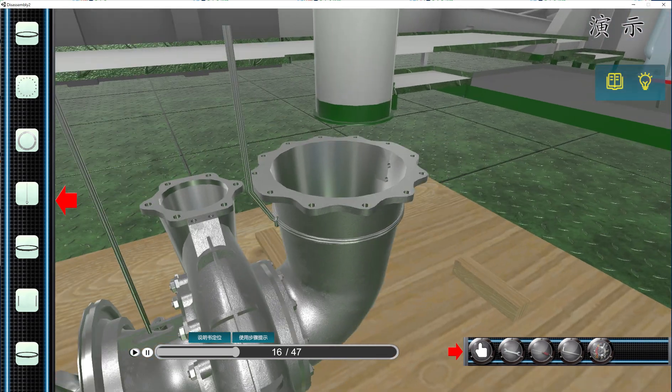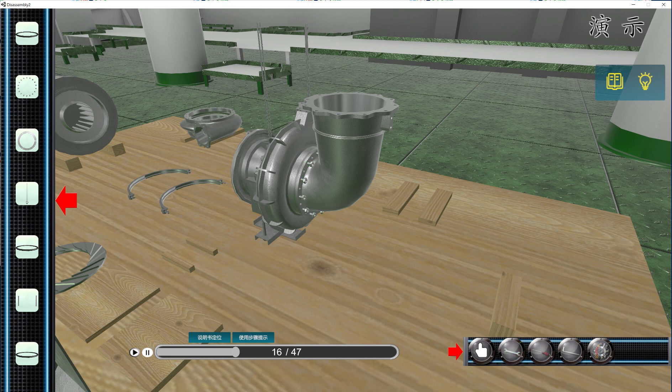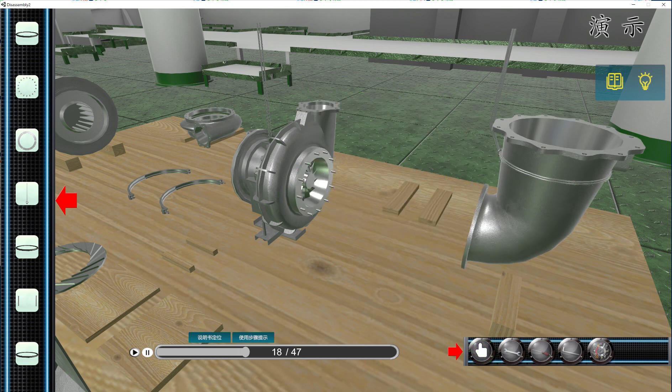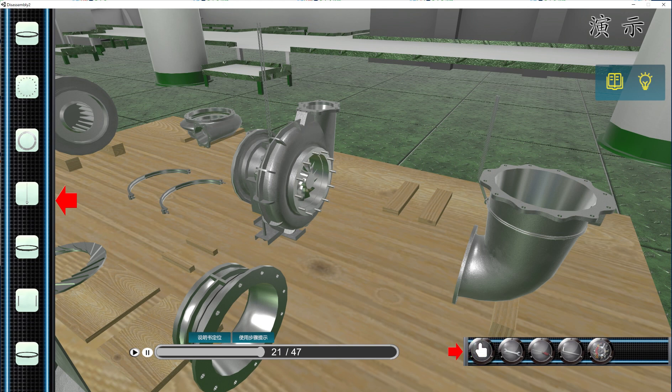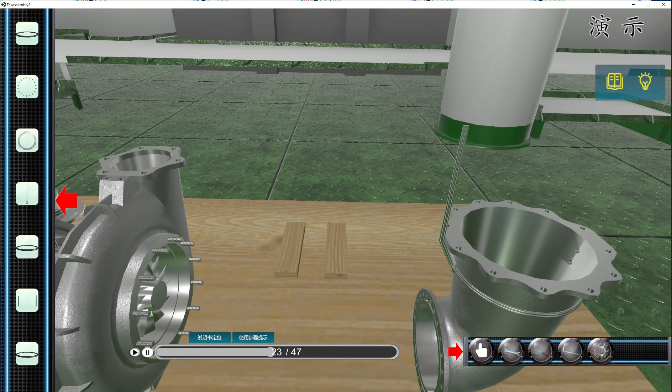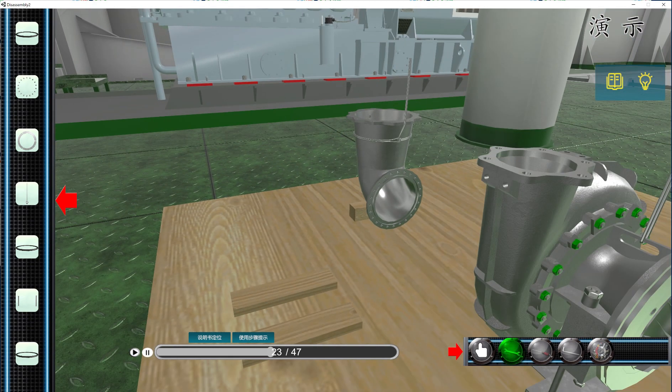It's a very nice job — you need to have the feeling of the shaft, whether it's touching somewhere or not, whether your turbocharger is aligned. There are really a lot of factors to take into consideration. Also this part here sometimes remains hung on the engine, so this part is also removable — there are some o-rings there. Here is one place which is really tricky — this is the most difficult thing to remove. Let's see how it will be done.